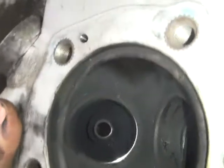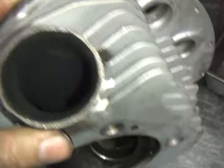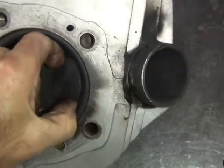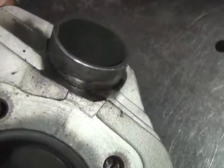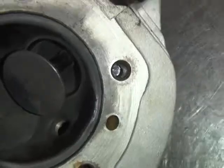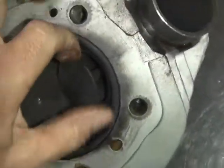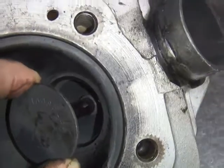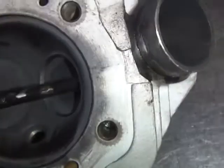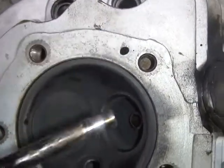So there's the exhaust. It's pretty restrictive in there, pretty dirty. So that's our rear head. This is our front head. You can see the oil residue on here from leaking out the tailpipe. Quick. So this one here, you can see the little bit of looseness. Nice burnt on black crappy oil.